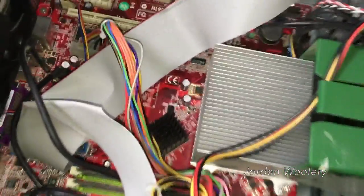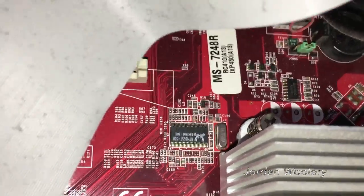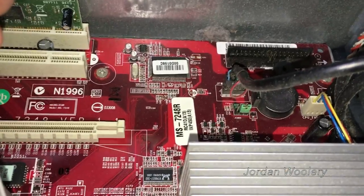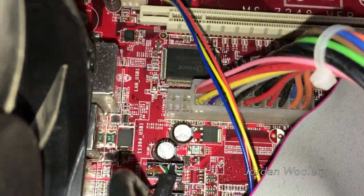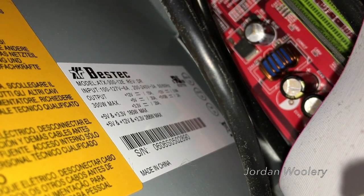There's also another MSI-branded chip — an RTM865T-300 — I'm not sure what that's supposed to do. There's a floppy port down there, and I believe the low pin count I/O controller is underneath that sticker, though the Winbond chip may handle that duty. This also only needs a 20-pin ATX power connector on the power supply, which is interesting because it uses a Pentium D CPU. It does get its 4-pin CPU power, but it's weird that there's no 24-pin ATX — a more powerful CPU would probably throttle the system.